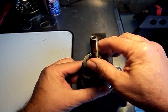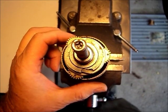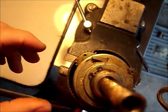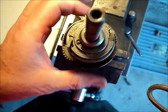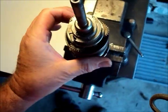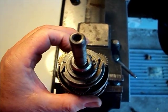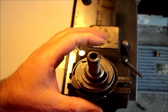Now, if we assemble it with even one of the shafts out of phase — say we've got these two in phase, but this one back here is out of phase — we can get a couple of rotations out of it before it starts to bind, and then it just doesn't want to go. If we completely assembled the hub this way with the shafts out of phase, put it in the bike and started pedaling, when it got to that point where it binds up, something's going to give. That something would probably be a sun gear — we're just going to break a sun gear. Even with one shaft out of phase, it's binding up.